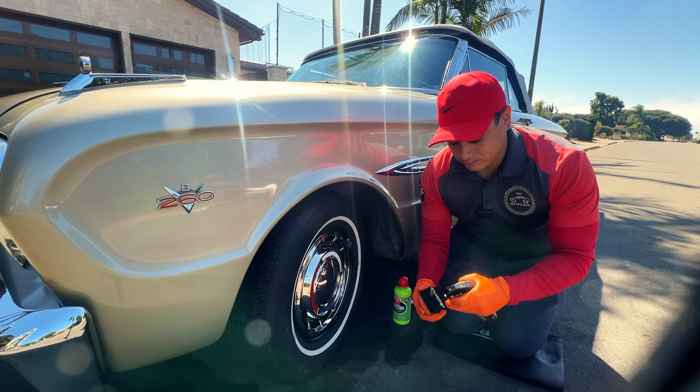Now I'm going to show you how to clean the glass, and we're going to use the same thing. Rinseless wash in a bottle is actually really good for cleaning glass. All we're going to do is take our solution, give it a light mist, and take two towels. One towel is for the cleaning, and the next towel — always completely dry — is for buffing off. We call this the insurance wipe: making sure none of the chemical was left behind and we didn't leave any streaks. Then look at it from all angles to double check there are no streaks left behind. Repeat that process throughout all the windows and all the glass.